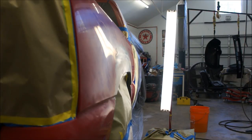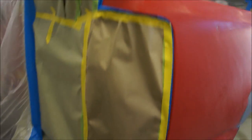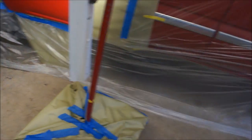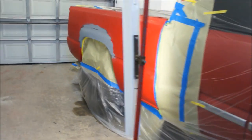I wasn't planning on sealing this, but I broke through a couple of little tiny spots — probably wouldn't matter individually — and then there were two or three spots I needed to seal up, so that's why I decided to go ahead and seal all of it. There are some rock chips underneath there I wasn't real concerned about, but I'll go ahead and throw a little sealer on that too. You can see how I did this — I tried to do as much paper as I can next to where I'm painting. I do have a little plastic down there that could flutter, but I'm going to spray upwards instead of spraying down at an angle, so hopefully it won't kick stuff up.